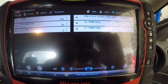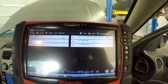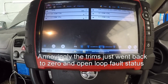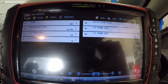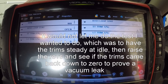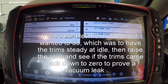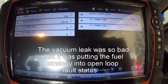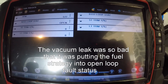We can see our fuel trims at idle are just maxed out on both banks. Obviously, like what we do when we think we've got a vacuum leak — there you go guys, closed loop fuel trims really high. Bring up the revs... it went to open loop, but we have got a major issue at idle — it's adding heaps of fuel. I'm suspecting a vacuum leak, so I'm going to get out there and put the smoke tester on. It'll only take two seconds to hook up.